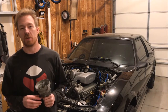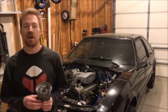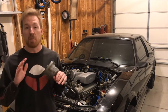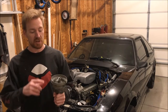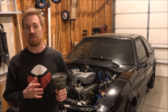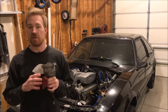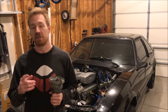Welcome back everyone to the GT40 head Fox Body Mustang swap. I finally got the intake on, got the wiring done, and probably screwed up some of the vacuum hoses. Today is the day we're going to stab the distributor in, so we need to make sure we're on cylinder number one on the compression stroke, top dead center, so this thing will fire right up. If your motor isn't firing and you think you have a distributor issue, this is going to help you out, so stay tuned.